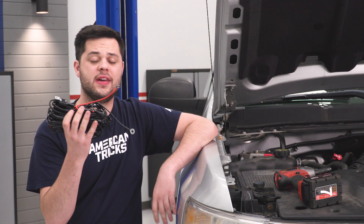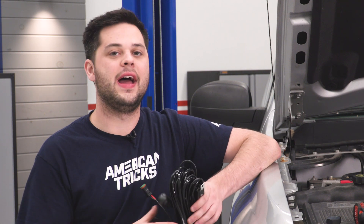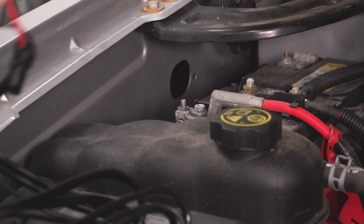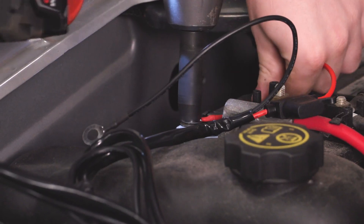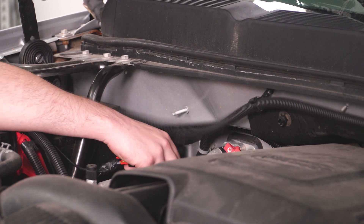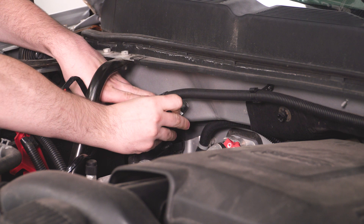Now we need to do a little bit of wiring — thankfully this is really, really easy. If I was doing this on my own truck, I would hardwire these lights into the factory harnesses. But if you don't have factory fog lights, this is gonna be the next best thing. First things first, we have these two contacts here — they're gonna go right to our battery terminals. Then we're gonna mount up this relay over here, feed the plug-and-play connectors underneath the truck, and get a switch into the cabin. We're gonna start with our contacts — just need a 10-millimeter socket to loosen up those terminals, and we can install these two underneath. Now we're gonna mount up our relay — along the firewall, you have this plastic clip on this stud, just gonna pull that off, put on our relay mounting tab, and reinstall.